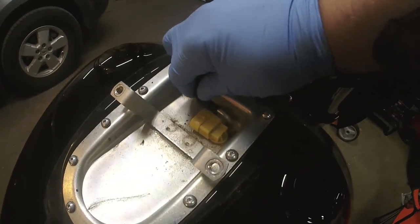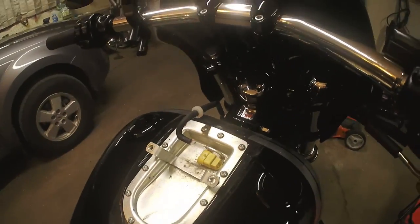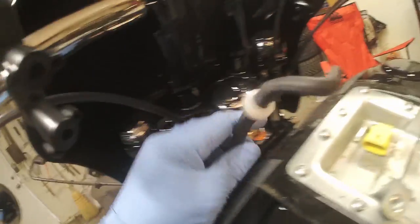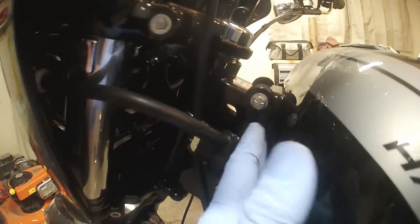This line right here just slides off — doesn't take too much. There's no fuel in that one, that one's just a breather line. Now just to keep this out of my way while I'm working, I took this fuel line and I'm just going to tuck it up by the headlight there, just something like that so that I can still get access at the bolts and I don't have to worry about it getting in my way when I'm working with the tank.